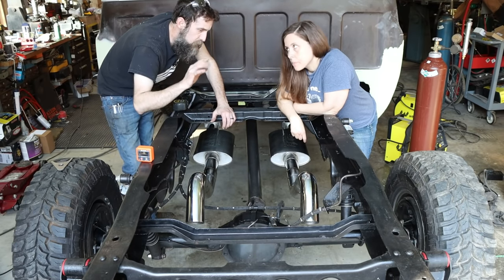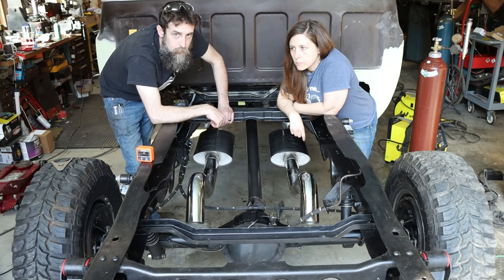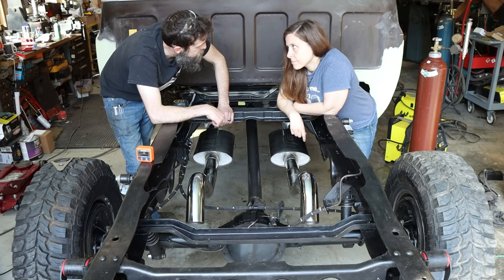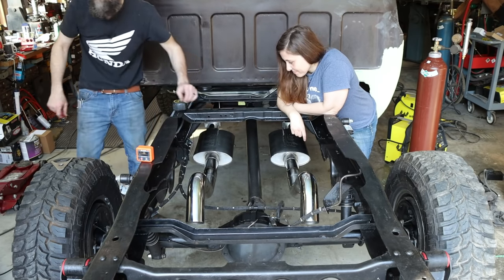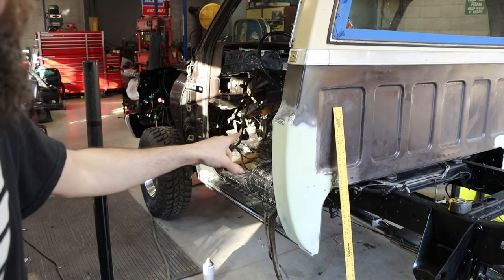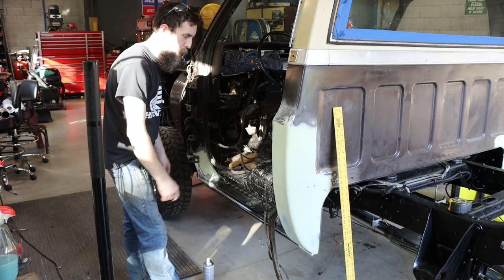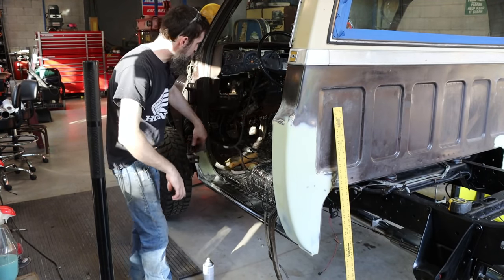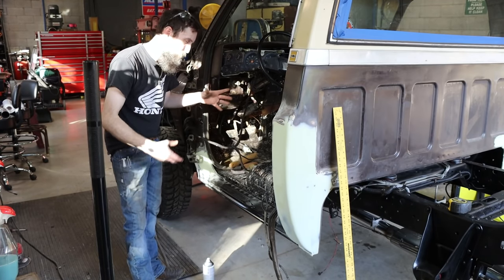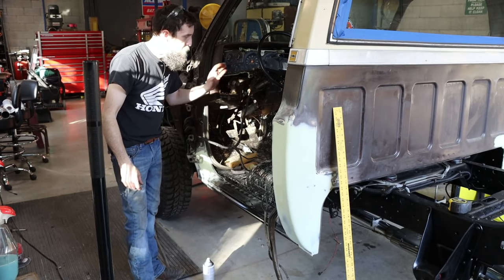So let me take you around and show you some of the other stuff that I accomplished this week, some things that I may not have shown on video, and wrap this thing up. Like I showed, got the wheels done, all four of them, and I started the body work on the cab corners and the rockers, and I'm probably about halfway done. Also rewrapped the electric harness that comes into the doors. It had electrical tape that had gotten gooey and was all falling apart, with some super awesome tape